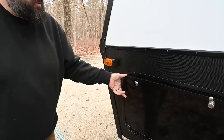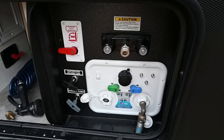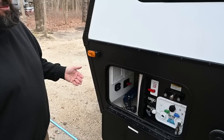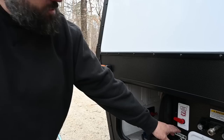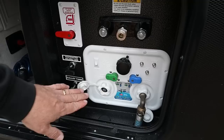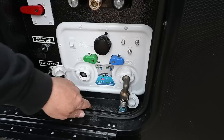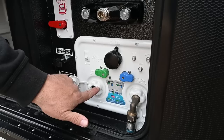This is a Murphy bed model. You're looking at the Nautilus system here, which controls all the water in this RV and the tanks — something you'd see more on a high-end fifth wheel, not a 22-foot adventure trailer. I had the Nautilus on my last RV and love having it here. You can winterize the Combi right here, you have an outdoor shower with hot and cold water, a black tank flush, pull your black and gray tanks, do your winterization, and sanitize the freshwater tank. It has a diagram — for dry camping you want it that way, for filling tanks you want it like that. Right now I'm on the city water setting.